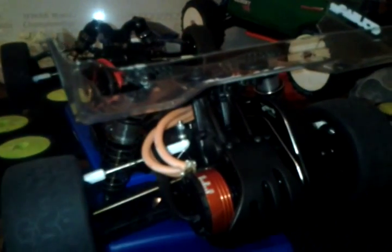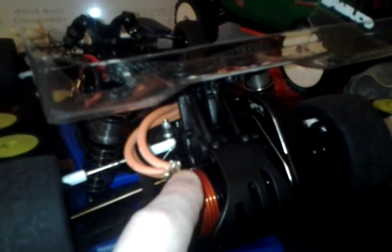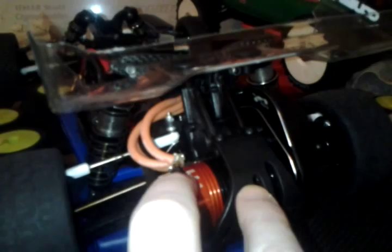You don't have to take apart your slipper clutch and the gearbox, you can leave it all intact. You can just take all that off, your slipper, gearbox, everything, as one piece. And as soon as you pop that off, your diff is sitting in there by itself. It sits in there on the aluminum braces for it. That's awesome. Completely awesome. I love that design.